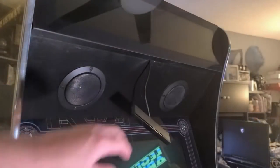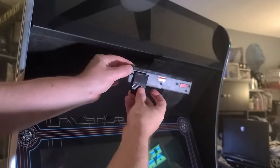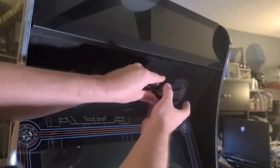Now we'll reposition the bit LCD and make sure there is enough length to mount the sensor bar without pinching the sensor bar USB cable. Underneath the sensor bar, we'll remove the red backing and then go ahead and affix one of the two 3D printed mounts. Then we'll repeat the same for the opposite side of the sensor bar.